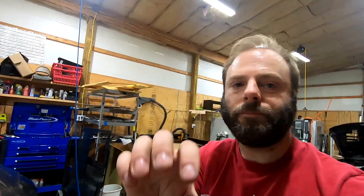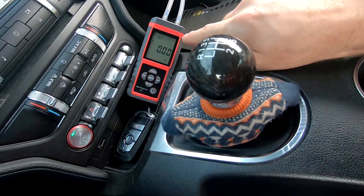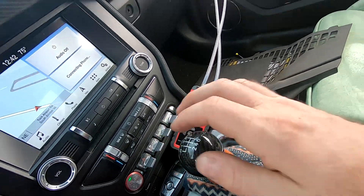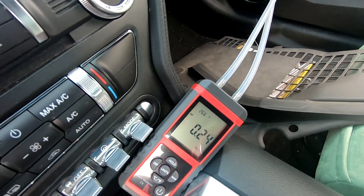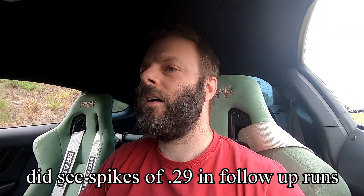If you remember from the front view, you were able to see light underneath the radiator, and now we're all sealed up pretty good. So we're going to go take it for a drive and see the pressure difference. All right, we're about to do a run with our lower baffle in place — set up again, difference in inches of water, we're zeroed out. Coming up to 60 — I saw 0.27.